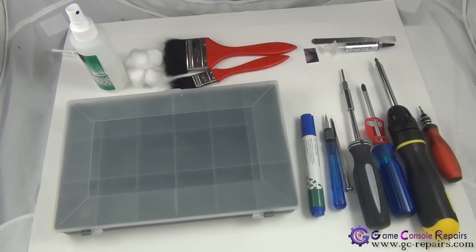In this video we'll be fully taking apart a PS3 console, cleaning it up as best as we can, and replacing the old thermal compound with new Arctic Silver high quality thermal compound. A quick note: PS3 is a dust magnet and if not cleaned regularly it can become very dusty and dirty. Like any other machine it needs regular servicing. One of the main reasons for system failures or Yellow Light of Death is the processor becoming very hot, causing cold solder joints and eventually giving up.